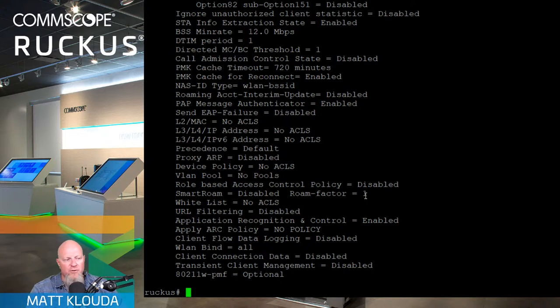And you can look through logs in here and it'll show you if you have clients disconnecting from the access point, it'll give you reason codes. You can translate those. They're well documented, an industry standard thing. You can go in and figure it out. So if the client left, it means it got too far away and it's having troubles with that.